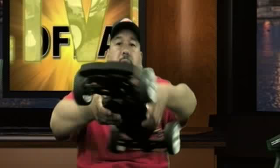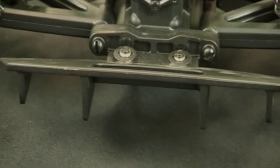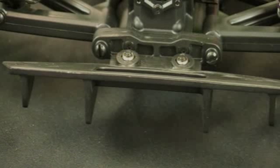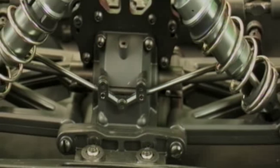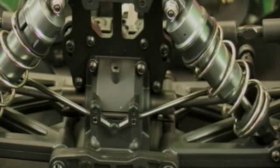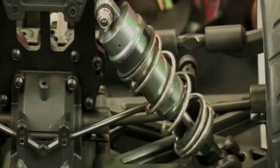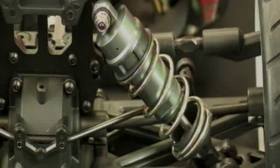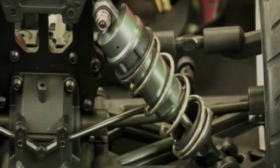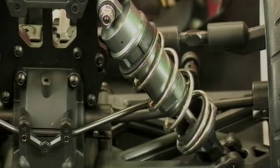Moving to the rear of the car, it has a diffuser bumper — typical on a modern race car — which is supposed to help with high-speed corner steering and does offer a little corner speed assistance. The 16mm rear shocks are slightly longer in travel. They have adjustable ride-height clips and are oil-filled, so you can adjust oil viscosity for the right track or outdoor conditions.